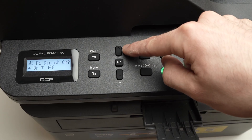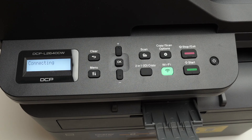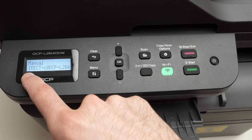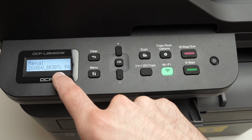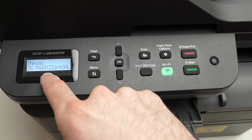Press the plus button to enable Wi-Fi Direct. You'll see 'Connecting' — just wait. Then you're going to have the name of the printer on the display. As you can see here, it's going slowly, and then you have PASS with the password.